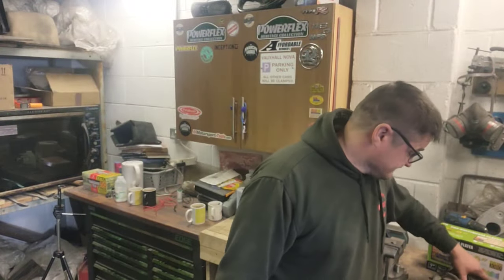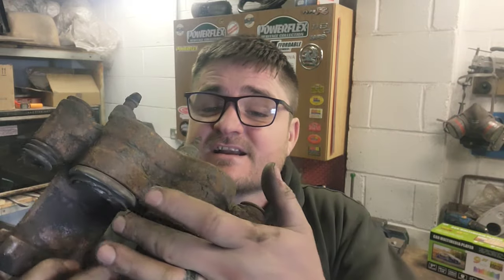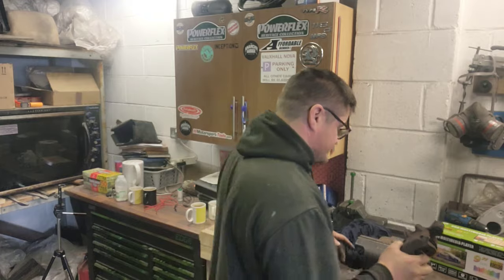That's the first caliper off. I'm going to do them one at a time. Now on these it's not the calipers themselves that have seized — it's actually the pistons. It's a twin piston setup. Normally they've only got one flexi hose going to them and it shares the chamber inside between the two pistons pushing evenly. However on this one, for whatever bizarre reason — you'll love the French — there are two flexi hoses. What I had to do on one side was physically take the flexis off the steel pipe to unscrew the flexi, then put it back on the steel pipe after clamping it to stop fluid leaking.